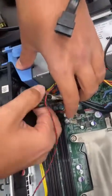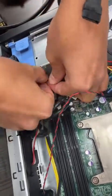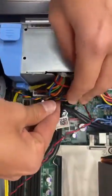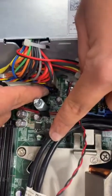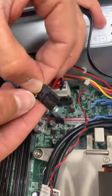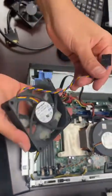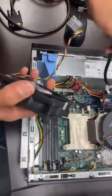Now disconnect the fan cable. Remove the cable from its holder carefully. This is the only cable that goes to the rear fan. Move the other cables to the side — there's a switch that you press with your nail or finger, then pull the cable upwards. Once you've released the fan mounts and disconnected the cable, the defective fan should come right out.